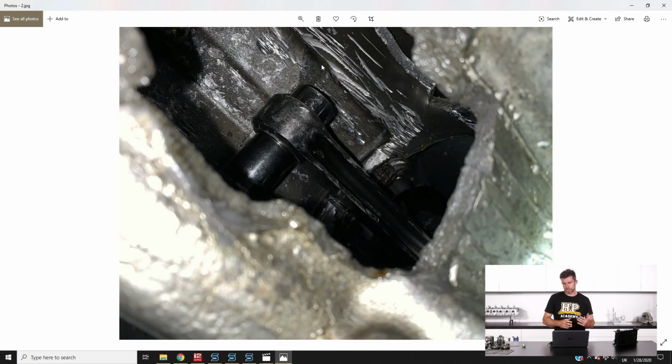This isn't an engine that we've built, so this was built for the last owner by a race shop here in New Zealand that specialises in building 1UZ for stock car use. So they're a relatively basic 4-litre stock car engine. They are limited in the compression for that class to, I think off the top of my head, 10-to-1 compression. So with this and the fact that they only produce around about 400 horsepower in the stock car class, 450, there isn't really a lot of need to go to an aftermarket forged piston. So they actually run with the stock Toyota cast piston. As you can see there from that photo, they do run an uprated H-beam connecting rod, and part of that is due to the fact that this engine ran through to about 8800 RPM.